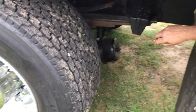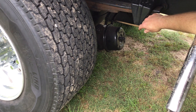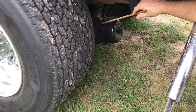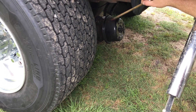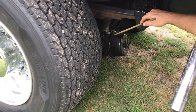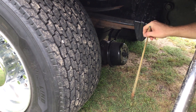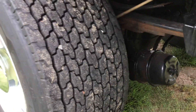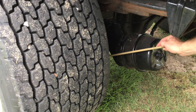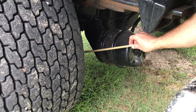From there, we'll do the brakes. My brake lines are properly mounted and secured. All hose clamps and fittings are present and tight. They have no abrasions, bulges, or cuts, and they're not leaking. My brake chamber is properly mounted and secured. All nuts and bolts are present and tight. It's not cracked, bent, or broken, and it's not leaking. My brake chamber clamps are properly mounted and secured. All nuts and bolts are present and tight, not cracked, bent, or broken. My brake pad is properly mounted and secured. All nuts and bolts are present and tight, not cracked, bent, or broken. I have more than one-quarter inch of thickness in my brake pad material, and there's no oil, grease, or debris.